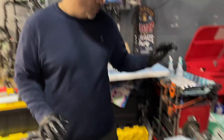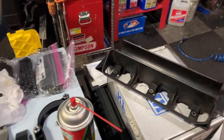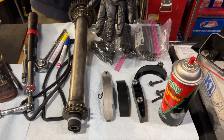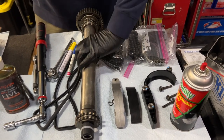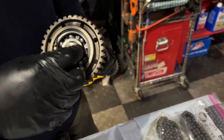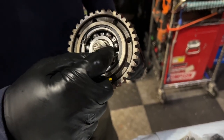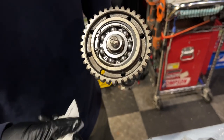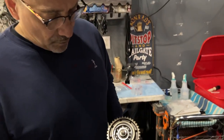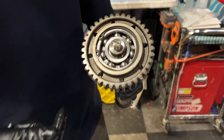Now the next part of the assembly is to do the IMS with the baffle. This baffle is meant to minimize the aeration. We're going to install all of these things here: the chains, the guides, and the intermediate shaft. One note about this particular intermediate shaft. Thanks again to Lee from Hardtech. I went with an SKF bearing, which is an open design, so the oil will flow through. He puts these on every engine that he builds, and he's one of the most recognized engine builders for Porsche out there. He recommended it, I bought it for $17, the real deal. SKF. $17!